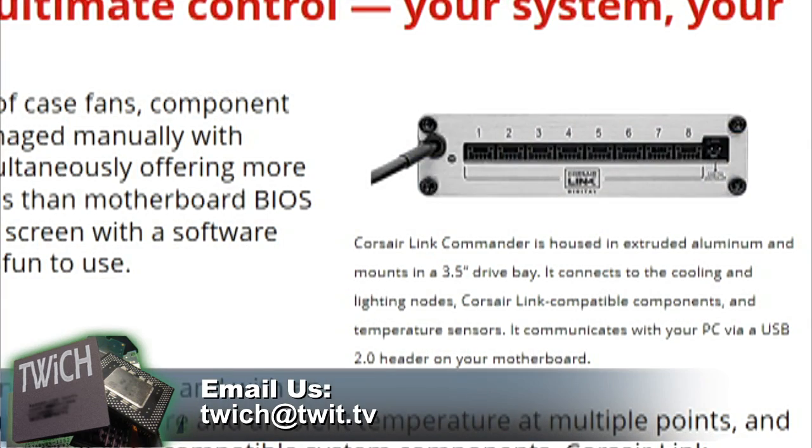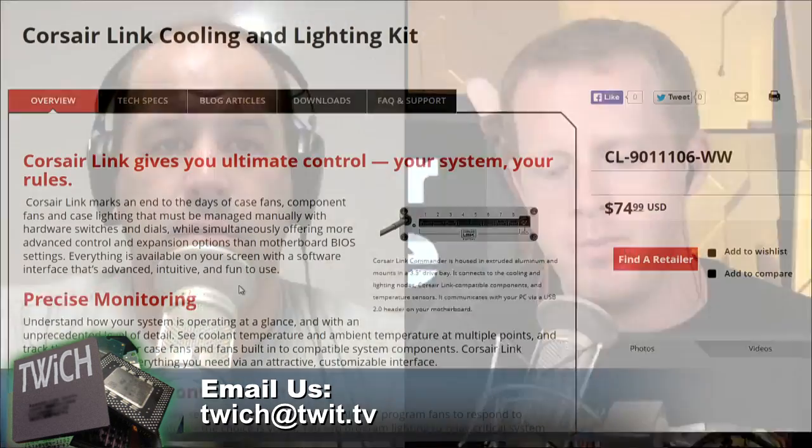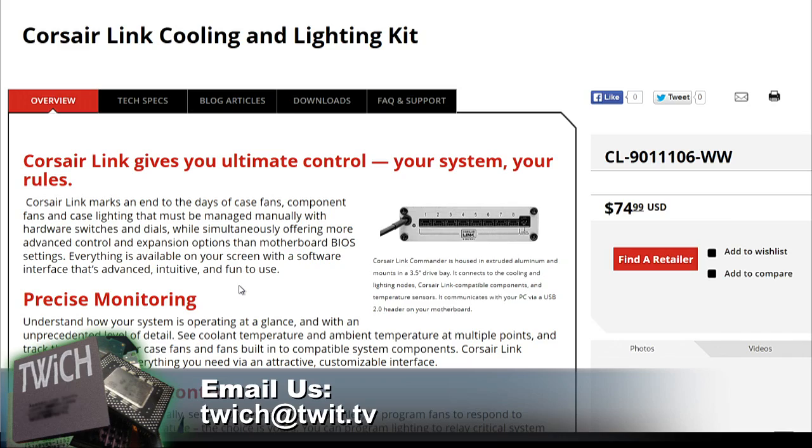Housed in extruded aluminum, mounting in a 3.5 inch drive bay, connects to the cooling and lighting nodes, Corsair Link compatible components and temperature sensors, communicating with your PC via USB 2.0 header on your motherboard, and basically lets you track just about everything inside of the system. It's not cheap, but it's pretty cool. I like the idea that it connects to an internal header, so you don't have to run a cable outside of your system and back into a USB port. Then you can control all those fan headers and monitor those temperatures through software. You don't have to have any kind of big, ugly fan controller on the 5 1/4 inch bays of your system.